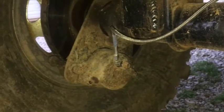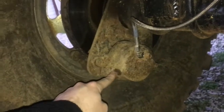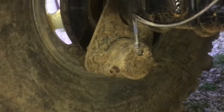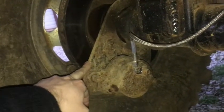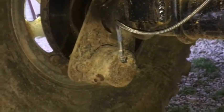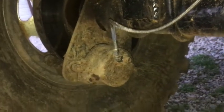The brakes then go to a bulkhead fitting here and feed down via a stainless steel line to a tee that distributes brake fluid to both rear calipers. I understand this is not a conventional setup — having the brake caliper mounted to the bottom is a bad setup. You'd think I couldn't get a good bleed on the system, and it's also exposed to stumps and rocks. But I don't have any problem with my rear brakes as far as bleeding goes. I can lock these babies up no problem, and these are GM disc calipers on the rear.